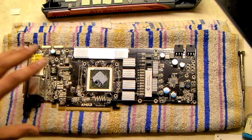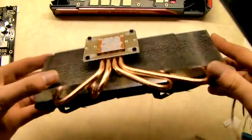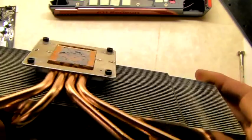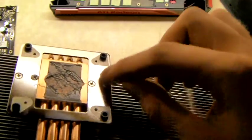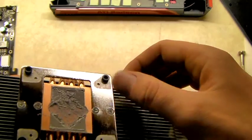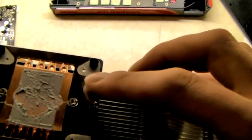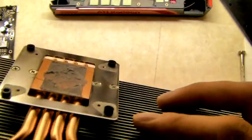Now that all that's been prepared, the cooler is ready to be seated onto the GPU and secured in. Before we fit the Twin Turbo Pro heatsink to the graphics card we have to make sure that we fit the spacers which are provided in the pack. You just unpeel the bits of paper underneath — that gives you a tacky compound — and then you stick all four onto the alignment which is going to be suitable for your graphics card. Mine are the outer sides and as you can see I've got all four on there now.